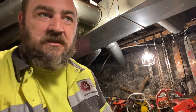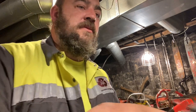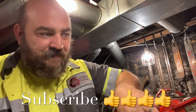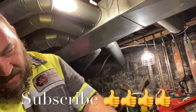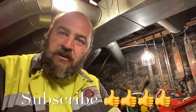Now this cylinder is really dry so I'm gonna put a couple of drops of oil in there. I won't get a good compression reading with it being dry, so let me put a couple of drops of oil in there and hook up the compression tester. I didn't put a whole lot of oil in there, just a couple drops just to make sure it's lubed up.